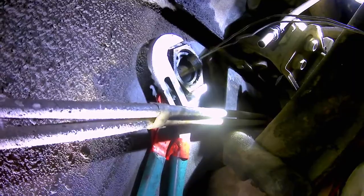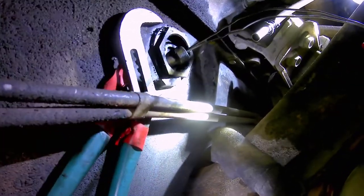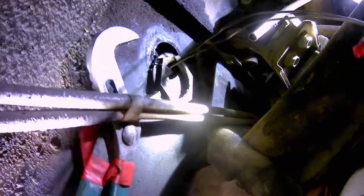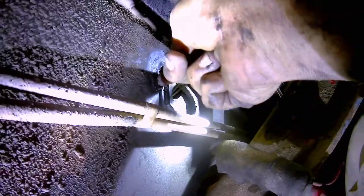I pulled back the transcooler lines a little bit to slip my channel locks underneath, which allows you to get the grip you need to pull that nut free. Once the nut is free, get your channel locks out of the way. You'll see that the unit fell inside the oil pan just like I said it would, and the tool prevents it from being lost. Slide the nut up and over the tool, and then pull the adapter back up into the hole.